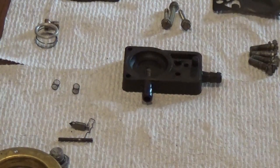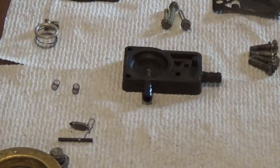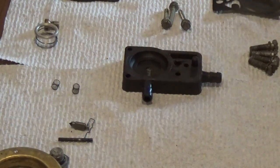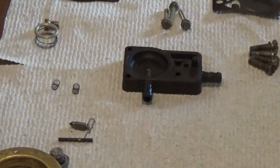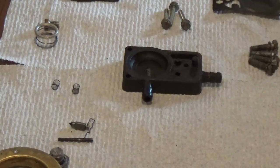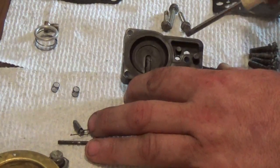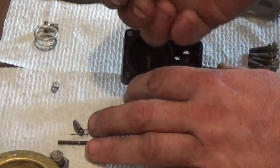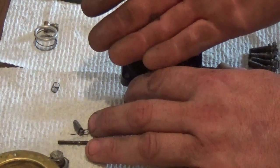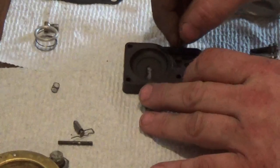I want to note that the next parts I'm about to show you are critical to make this fuel pump work, and they are the most typically lost parts in this assembly. I'm also going to show you on the pump body where these little tiny springs actually go. If you lose one of these springs, it is a pain in the butt to get one of these to run or even expect to run properly. I'm going to try to tilt this pump body up and show you where these springs go. As you can see in my hand, these springs are extremely tiny, and they are a pain because they fall out very, very easily. What I like to do is dab a little grease on the end of them and put them in their respected spot.